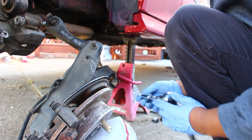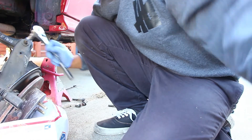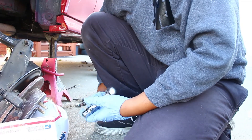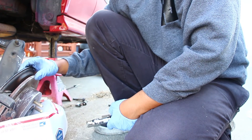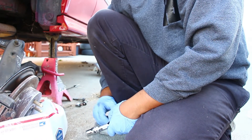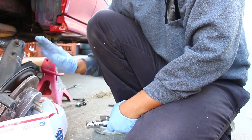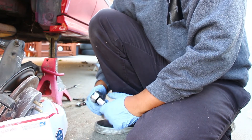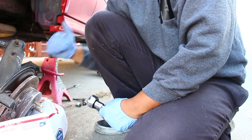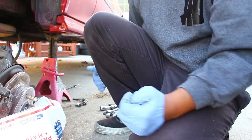If you're wondering why I'm replacing the emergency brake lines - it is rear disc, as you guys can see. For my car specifically, non-SIs I believe have drum brakes, so I replaced the whole arm to rear disc from an Integra. Then you just need a '99-2000 SI emergency brake line and everything should be legit. The whole arm is finally off, guys - we're going to move to the shade because it's getting hot.